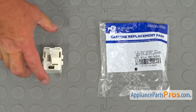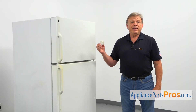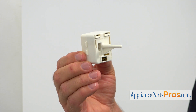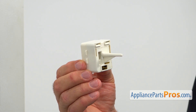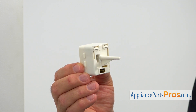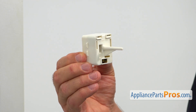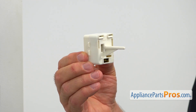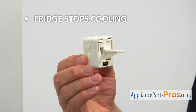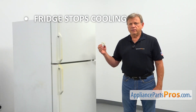When you open up the package, you're going to get a new compressor start device. The compressor start device is a combination of the start relay and the compressor overload protector. The relay assists the compressor to start by turning on and turning off the start winding. The overload protects the compressor windings from overheating and drawing an excess of current. It's mounted on the compressor terminals on the side. If your fridge stops cooling and you can hear the compressor clicking every few minutes or less, check the compressor start device and replace it if needed.